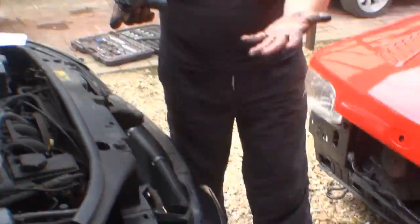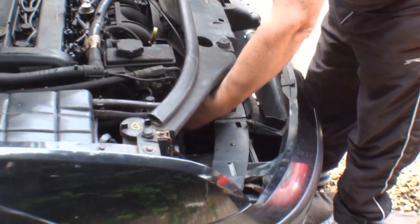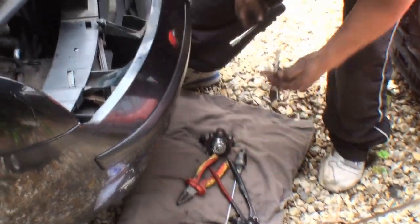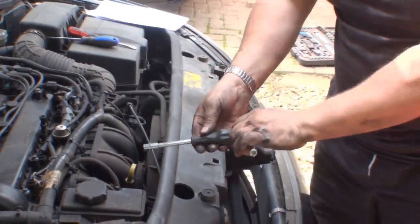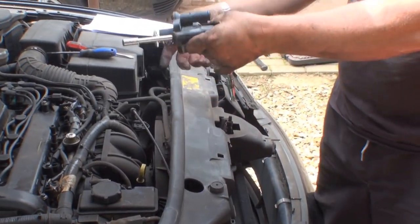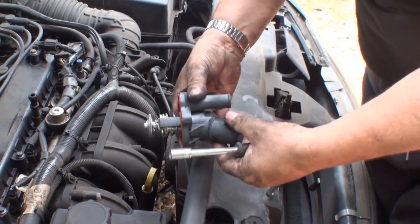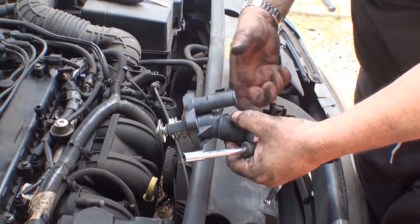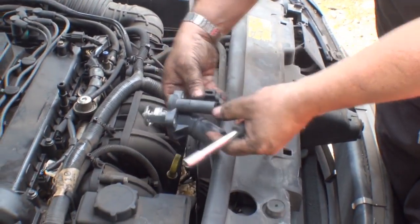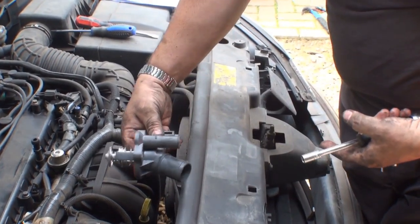But as you can see, I'm actually covered in muck. I've got a little graze on my arm, because the hardest thing is that you're trying to work in this little area here, and you're undoing the nuts with a little 6mm. There's only 3 nuts, but you have to have a tool like that to get on there. And there's 2 nuts at the top, which are these two, which are pretty okay to get to. And then there's one at the back there, as you can see, underneath, which you have to fiddle in between here and through here and undo. I didn't take them right out. It enabled me to get enough pull to release that. And then the electrical connection, you have to press the top and bottom. I've done it with a pair of grips, and that just pulls off. And that enabled me to then wiggle this out through that entrance there with that pipe still on, because I couldn't get that clip off with that in situ. So that's what you're going to come up against.